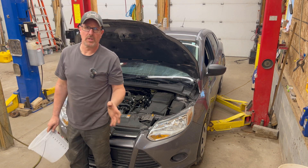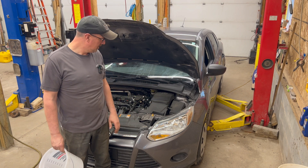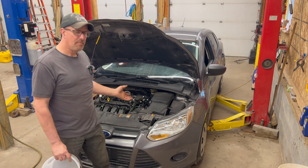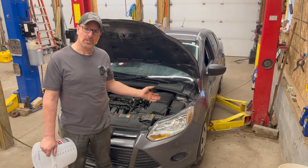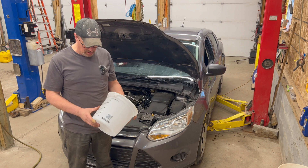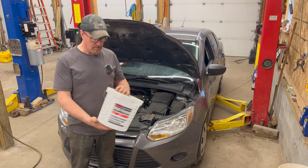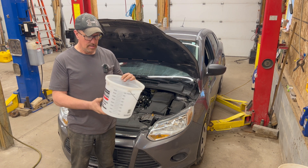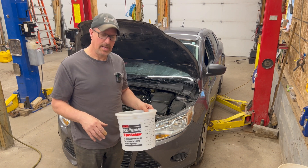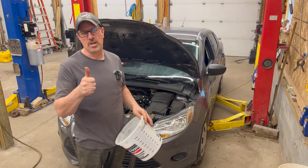This transmission was really simple to service. I have a hoist, but you could do it with jack stands and a jack — it's not that hard. On some GM platform transmissions it's easy to fill from the top; you drain from the bottom but still have to pull that plug out to know when it's full. Another alternative is a graduated bucket — I bought one off Amazon with liters, quarts, ounces, and gallons — so you can measure how much fluid you take out and put that same amount back in. Thanks for watching.